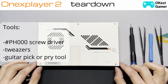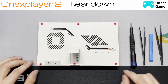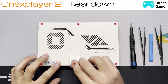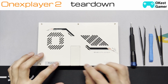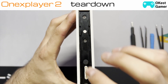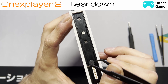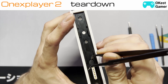There are six screws in the back you're going to want to remove — I've already removed them for this video, but there's one here, here, basically just evenly along the back. Don't forget the one under the kickstand; it will be under a warranty sticker so you'll need to remove that. There are four on each rail, evenly spread across. Under this sticker you're going to need to remove it, and don't lose the sticker — it's very important to keep because it prevents the pogo pins on the controller from getting stuck.